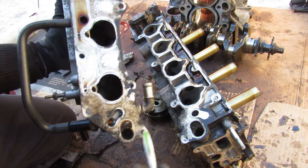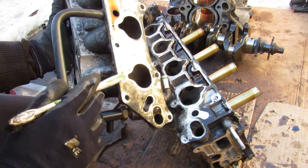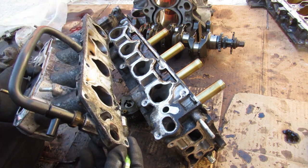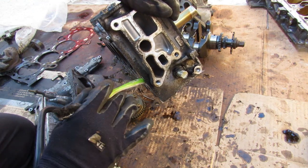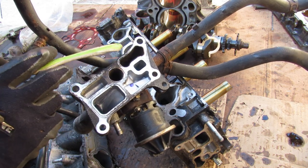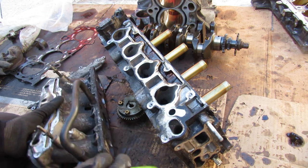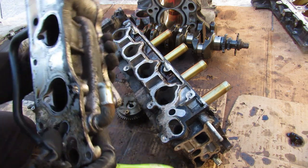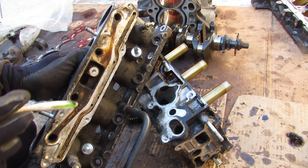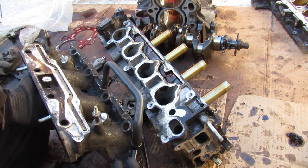When the engine warms up and coolant starts flowing through, it's going to shut off the flow of that air to stop the mixture from being so lean. In addition to all of that, we've got the head and intake manifold supporting the EGR system. The EGR system takes exhaust gases from this bottom half and brings them through this port — the EGR valve controls the amount of exhaust gases coming from the head, which then go back over to a port here, then through another port, then into the air intake, and from there follow a track at the bottom to get distributed into each of the intake ports to get re-burned.